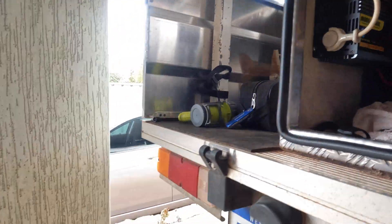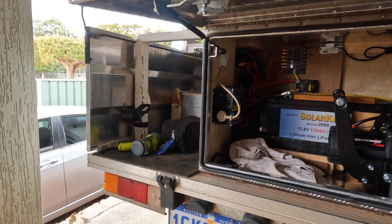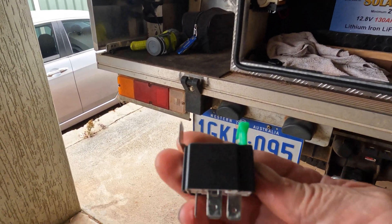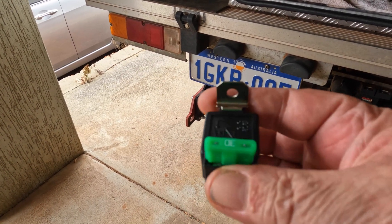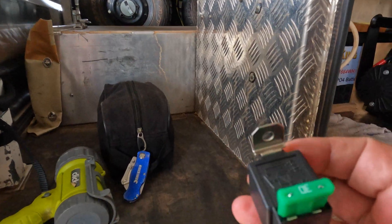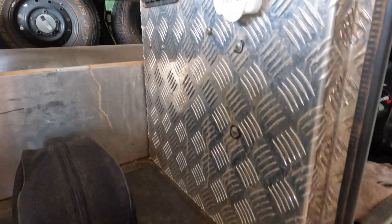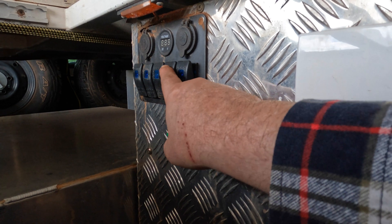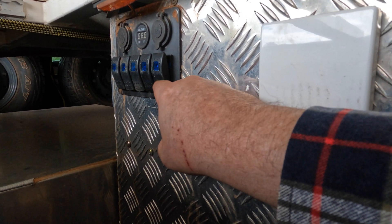What I'm going to be doing with it, because it's in this box, I'm going to be fitting a basic, very simple, fused 4-pin relay. It was a 30 amp rated — this one's 30 amp, it's got a 30 amp fuse on it. And we're going to simply do it so it can be switched on and off with one of these switches here, probably this one.